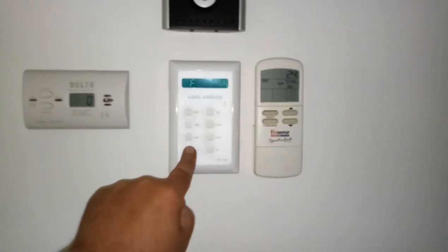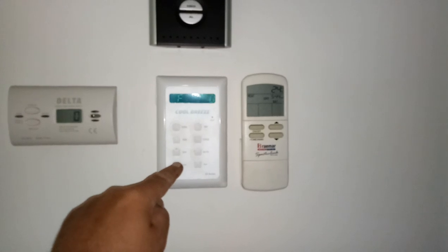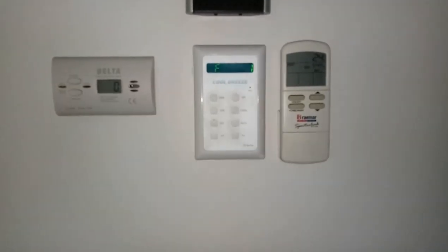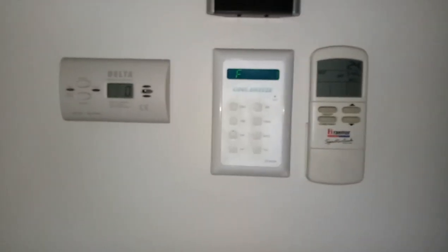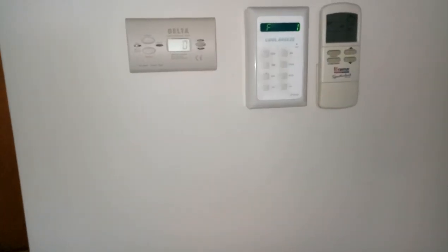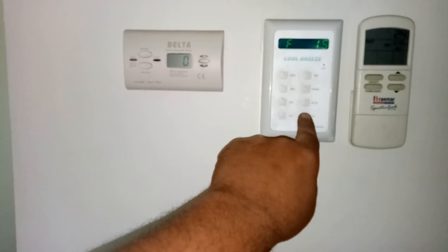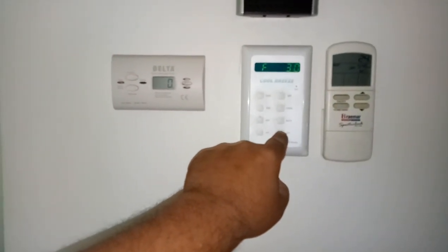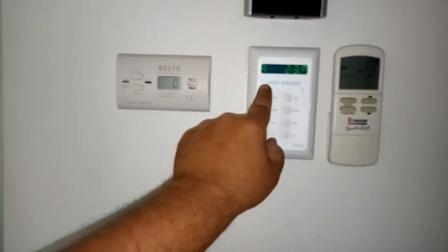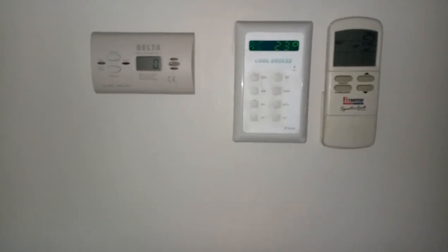I'm going to turn that back down to 50% and run it right down because before it would zap out on low speed as well — at minimum speed, which should be around 750 RPM on those fans. Whilst you're up there, it's good to check the fans for big cracks, because if you throw a fan blade that wouldn't be nice — it'll definitely destroy the plastics, thin steel, and even the cradle itself. I'm going to put it on AC mode: automatic, cool, set the temperature to 21 degrees. That will now start to fill the unit with water and we've got our air conditioning back.